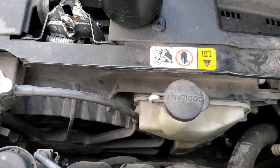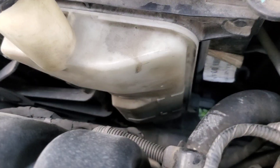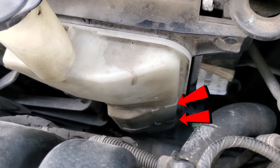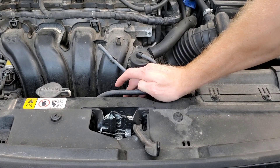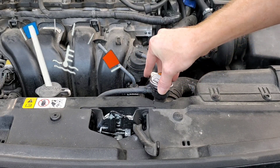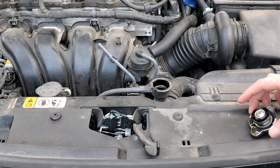You'll want to check the coolant and the fan to make sure they're at the proper level. There is a clear indicator of the level — notice the low and high markings on the reservoir. If the engine has completely cooled down and you want to allow a really long time, you can check after removing the radiator cap.